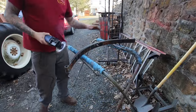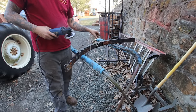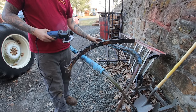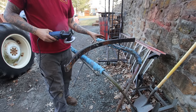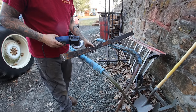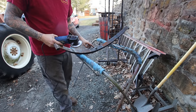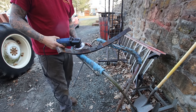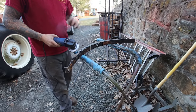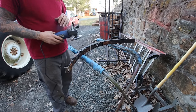So since we are using a 37 to 40 rear end, we're using that rear spring for it. It's a reverse eye spring, so I'll get a little bit of drop out of it, but it does not fit the 33-34 rear crossmember, which is meant for a curved spring. So I put the spring in the crossmember like you saw. I marked out an area right here where it's hitting. There's some interference, so I'm gonna take a grinder, shave a little bit off, and we'll bring the crossmember out here. We'll test fit it and keep grinding to get a good fit so we don't take too much material off. So let's get the grinder in and we'll make this thing fit.